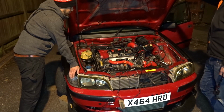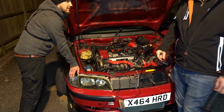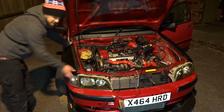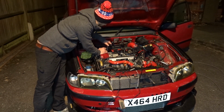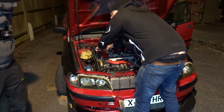The only thing that I thought of was quickly whip out the injector, check TDC is on that mark. Should we whip a plug out and see what colour it is? It should be wet after all that. Yeah, I mean, you might whip number 1 out and find that it's so wet, no wonder it's not running. Mine does that a lot.